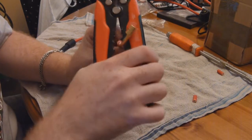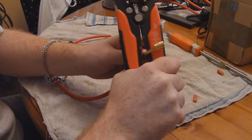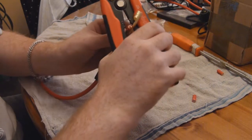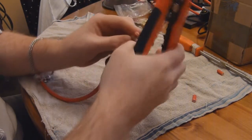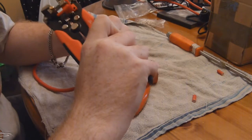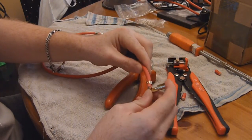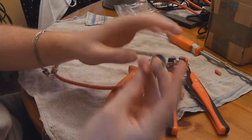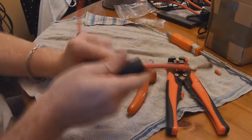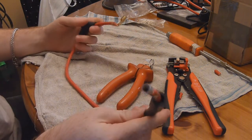Then just get your crimps and crimp it as best you can, especially when your crimpers are not that good quality. Just crimp it as hard as you can to get it in there and make sure it's well crimped. That is the worst crimping in the world right there - let me try and smarten that up. And there we go, that crimping isn't actually moving anyway. Even though it doesn't look well crimped, it's pretty much well in there. Then all you do is move the boots back over the ends and you'll have your HT leads.